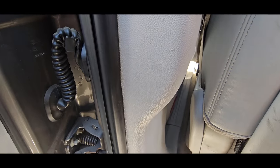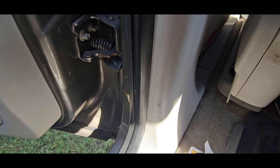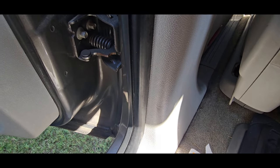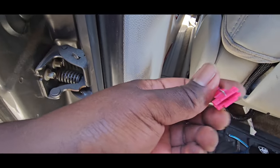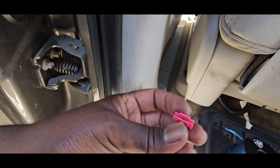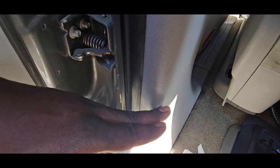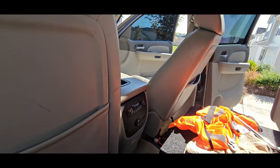You're going to do the exact same thing on the passenger side. Now down here at the bottom where the speaker wire comes through, you're going to have another set of speaker wire — you're going to have yellow and brown. The brown is the negative and the yellow is the positive. I use one of these connectors where you can put your wire on one side and then put the wire from the speaker on the other and just snap it down. So remember: driver side is yellow and brown — brown is negative, yellow is positive.